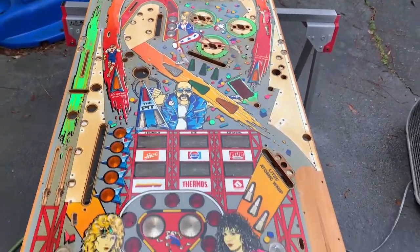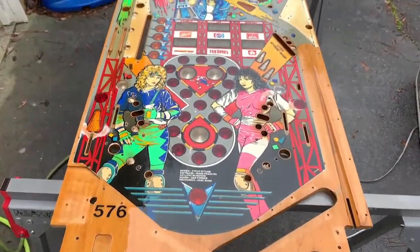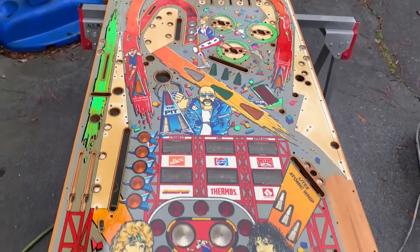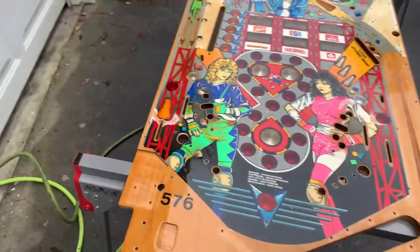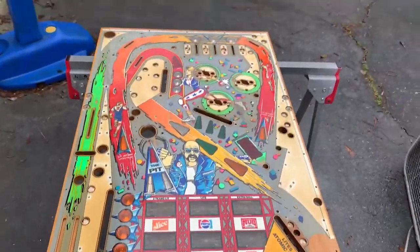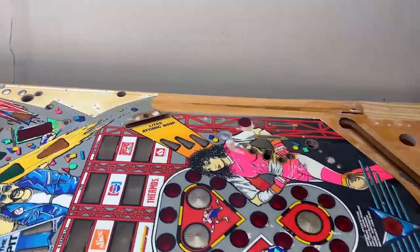I'm just trying to get all the bumps and stuff out of here. Eventually this is gonna be sanded as well. So this is far from a top coat, especially in these conditions that I'm spraying in right here. So I don't care if dust and all that crap gets in here before I put the next coat on, I'm gonna sand it anyways. So you can see with the certain light, there's still some bumps and some stuff that we need to work out on this. I did go ahead and sand everything at this point.